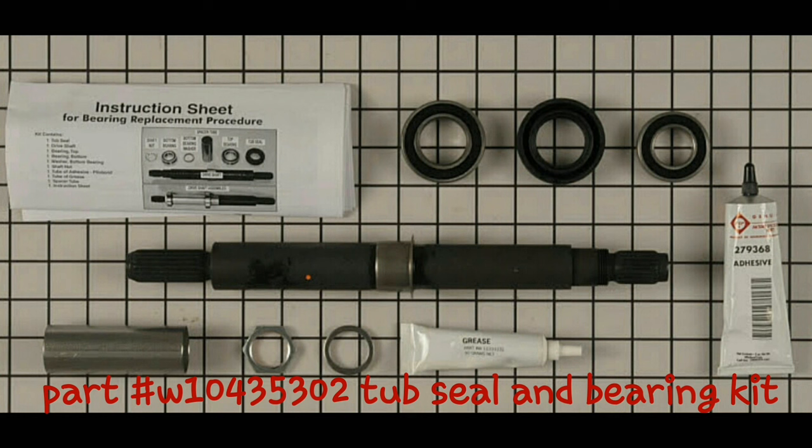This wide piece of tube is to help put the top seal in place. This is how you use this bar — you hit the bottom bearing first and just hit it in a triangle pattern. Don't hit the same spot all the time. Just hit top, bottom, side, side, top, bottom, side, side. Don't hit the same spot all the time. As you see it comes right off.